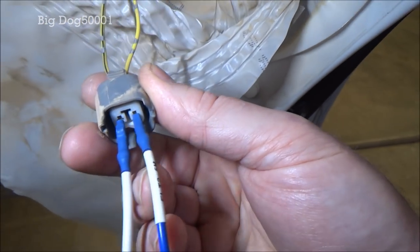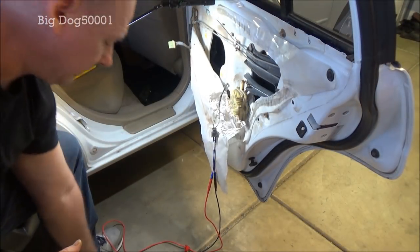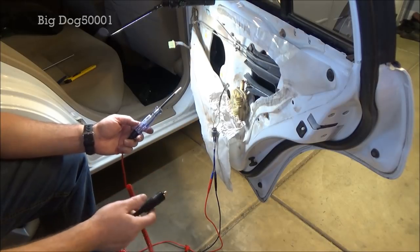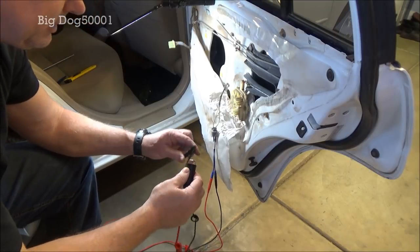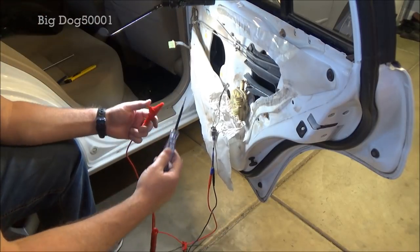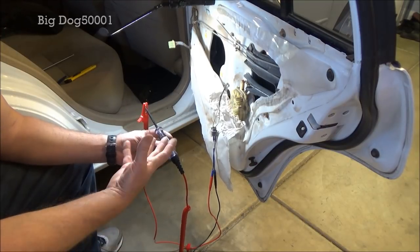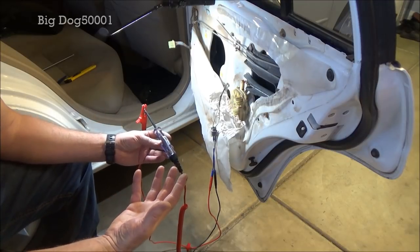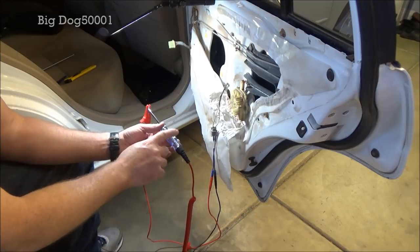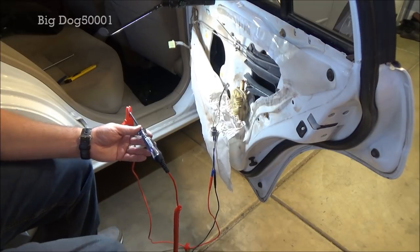You can see these terminate in alligator clips so I can put my test light right on there and make sure power is going in both directions. It's important to use the correct size probe — you don't want to damage these pins. Now that the test leads are connected, we'll use the test light in place of the door lock actuator to put a load on it. One side of the test light goes to one wire, the other side to the other wire. It doesn't matter which way the current runs through it — it'll light either way, just like the door lock actuator.